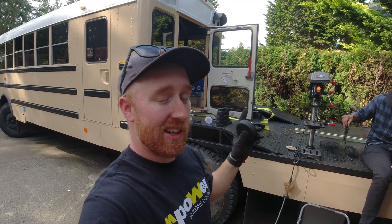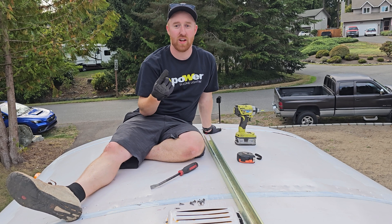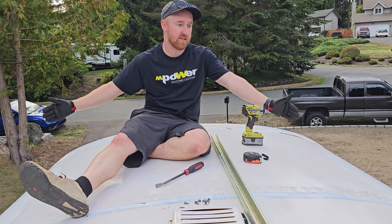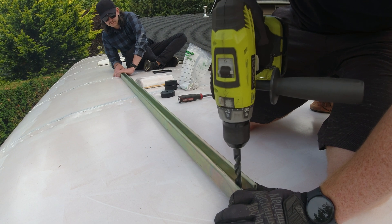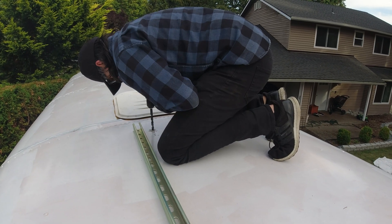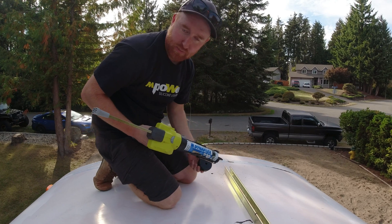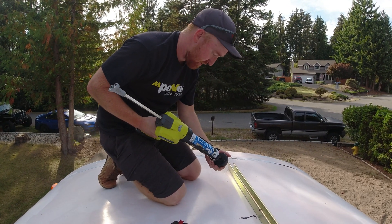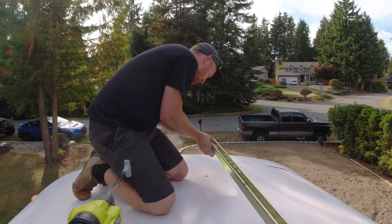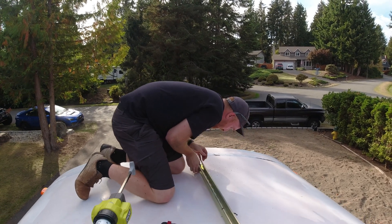Now we've got to start measuring out where exactly we want to put the strut channels. We're going to leave this vent in place since I sealed up everything else — it's probably a good idea to keep it. Using this strut piece here, we'll do another one, measure out 21 inches to the side and bolt it in. I'll take some black sealant and go around each hole to seal it up, since this will be a prime spot to leak. Then go down through the hockey pucks and through the hole.